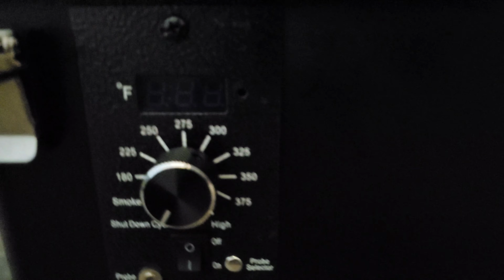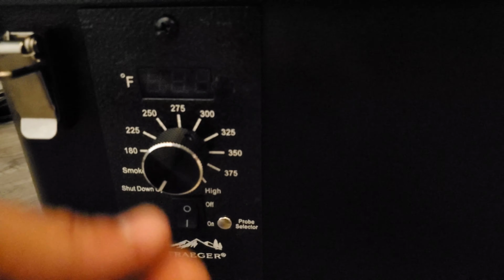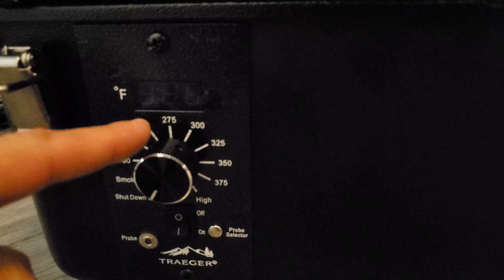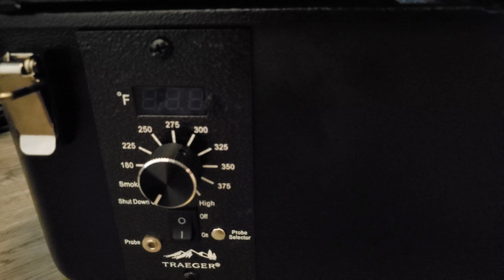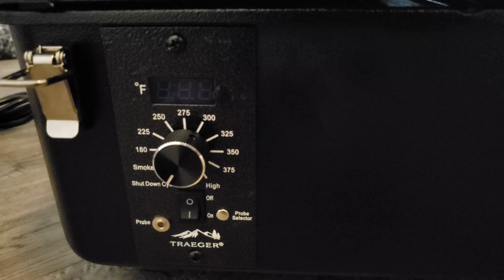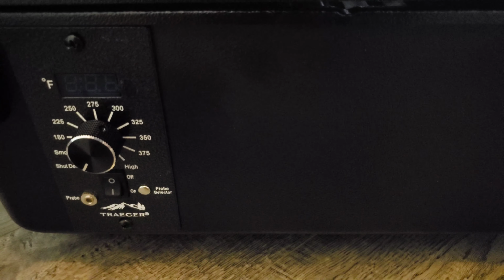and it comes off. And what that is, that little hole, it's the P setting. So what you do is you get a little pin or a paper clip, or I use a little drill bit, and you poke it inside, and what it does is there's a P dash number, whatever number 1 through 5 that comes out, and that P indicates pause, and it controls the auger speed that's inside.